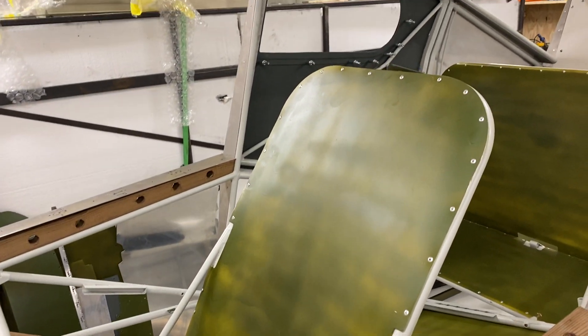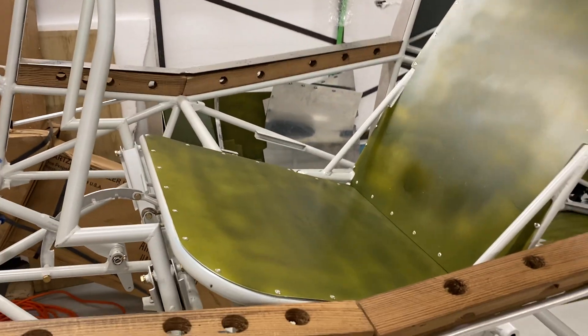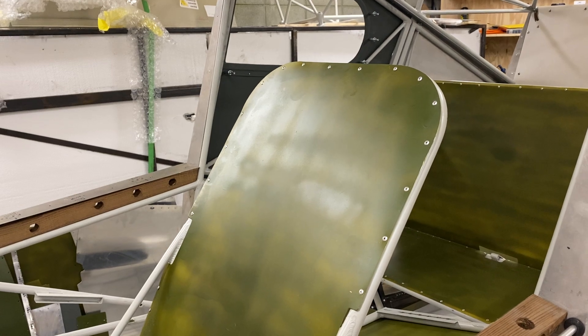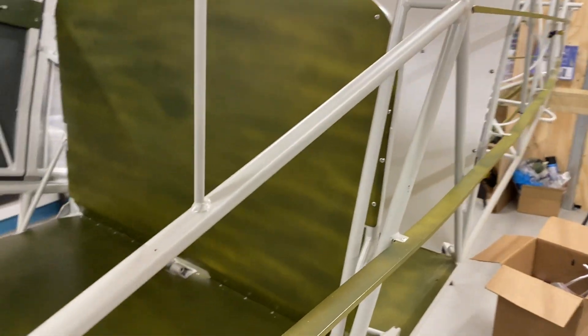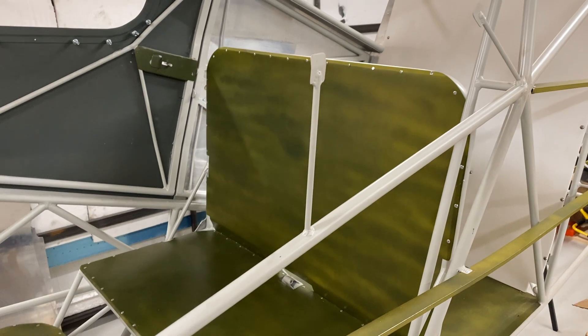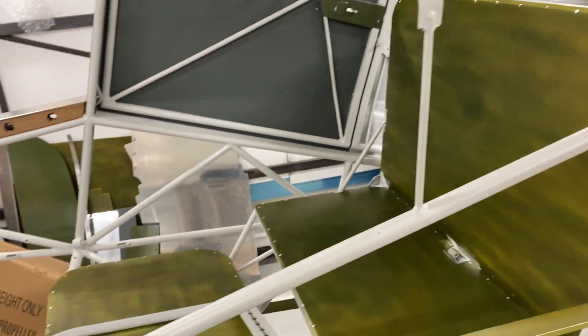These are the seats that I fabricated the pans for. The seats in the kit set come all welded and nearly finished to that extent. I simply drilled and riveted the seat pans in place — you do have to cut them out. I used a little bit of cardboard sheet to trace them onto, and it took a couple of days. They're all now ready to go to the upholsterers and can be upholstered right over the top.